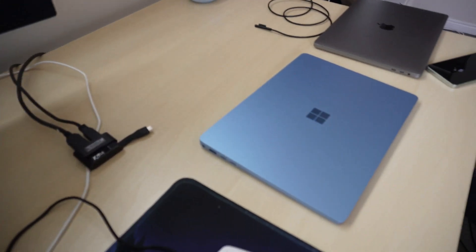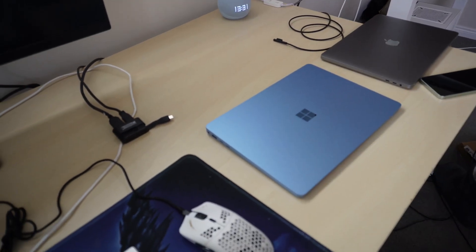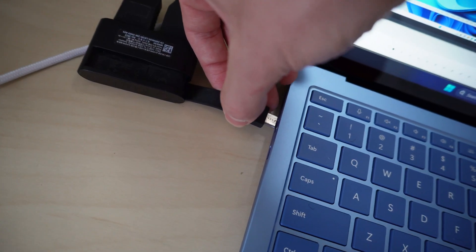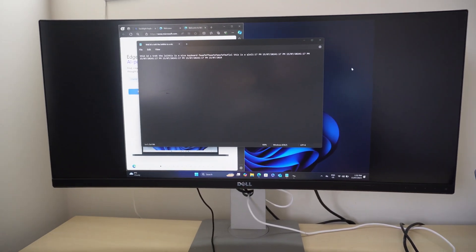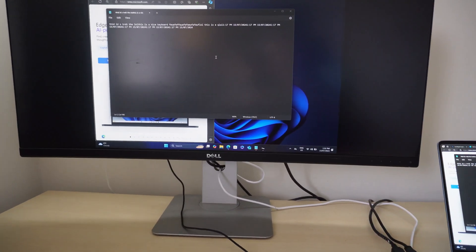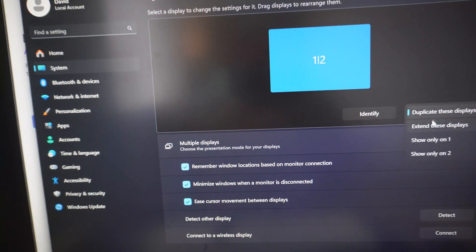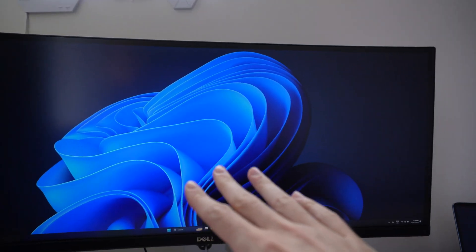I currently have a keyboard and a mouse plugged into my monitor and I want to see if I can connect it to my Surface Laptop 7 via a generic dongle instead of having to purchase their dock. So let's plug this into one of the USB-C slots. It's picked up the desktop, however the resolution isn't quite right. The mouse and keyboard are working, which is a good sign. If I duplicate the settings I don't get the full real estate of my wide monitor, but if I go to extend it works perfectly fine. So I've got my main monitor, keyboard, mouse, and extended monitor all set up nicely.